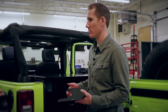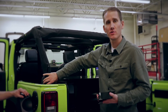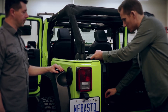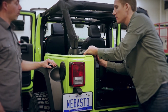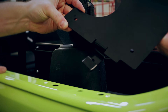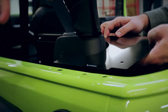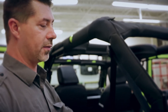Next, we're going to install the side wings. We'll start with the driver's side, and it's important to pay attention to the sport bar surround here — we're going to give it a nice even gapping around the surround. This will close out the side of the surround; just set it there, rest it there, and then thread your bolt through. Note that the previously installed cap is covering up an oblong hole. These oblong holes will actually align with your mounting locations for your OE hardtop — this is in case you want to do the optional install and bolt this entire surround kit directly to the hardtop hardware. The rubber safety cap just taps down into the normal location.